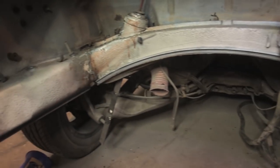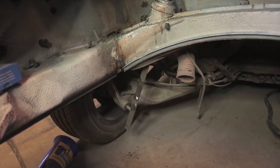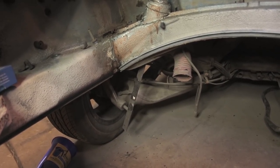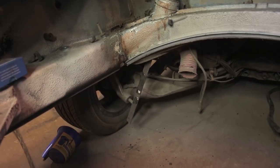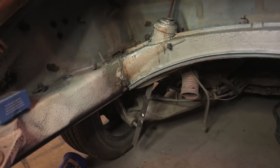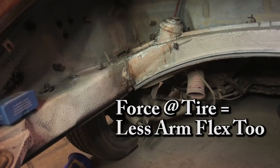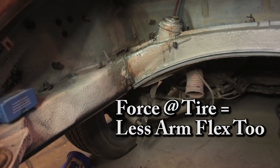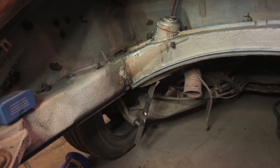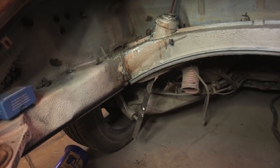So under high loading, especially with high spring rates or high torsion bar rates, that friction can become pretty significant, even if you use some of the aftermarket bearings and so forth. I do know that coilovers have a lot more adjustability, has the advantage of that force acting real close to the tire, and has options of progressive spring rates, high spring rates. You can use adjustable dampers, all that kind of stuff, all in a small package. It's also much easier to change the ride height. So it has its disadvantages here in the rear.